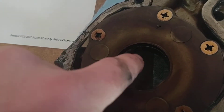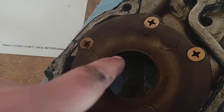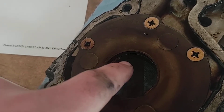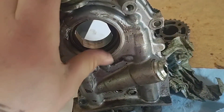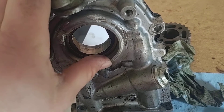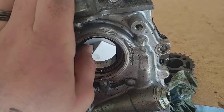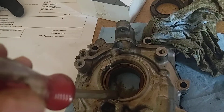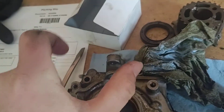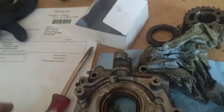The pump has a two square key, meaning there's a flat side here and a flat side here inside a circle. Those two flat sides sit onto the crankshaft where there's a corresponding shape — they basically just slide onto each other. The most obnoxious part of install is: slide the pump onto the shaft, and do not install the crank seal before you put the pump on the crank — it will make your life harder. Once it's on, you can see the alignment hole down in there and move it around with a flat head screwdriver. Look at your crank and match the alignment.